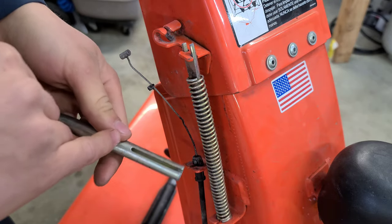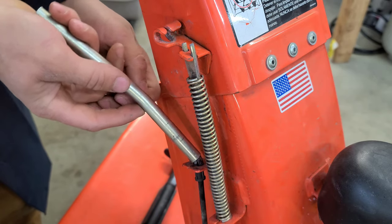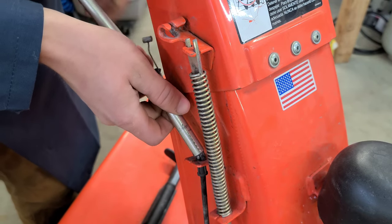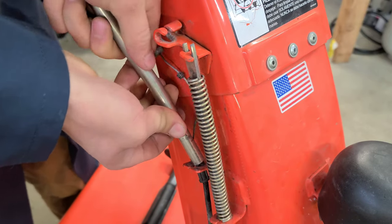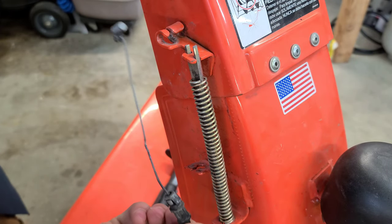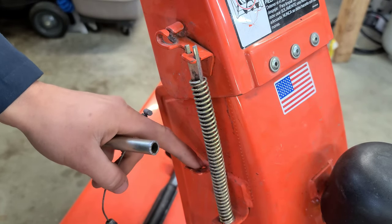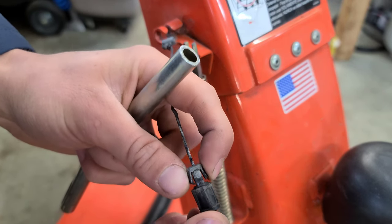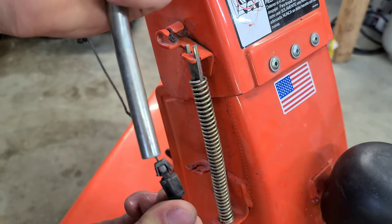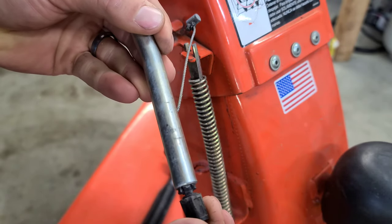I did make this tool out of brass. I cut out a little slot here and this tool is exactly what it's made for — it's made for removing the clips from the housing and you can use this for mowers. What you've got to do is just press all the way down and it'll squeeze both sides, then the cable can be removed. As you can see you do have two squeezable tabs here — that's how it holds on to the chute. You can use needle nose pliers and press it down, but I've just made a tool here that squeezes both sides when you push down on it. You just make sure that the cutout is there so when you push all the way down it squeezes both sides.